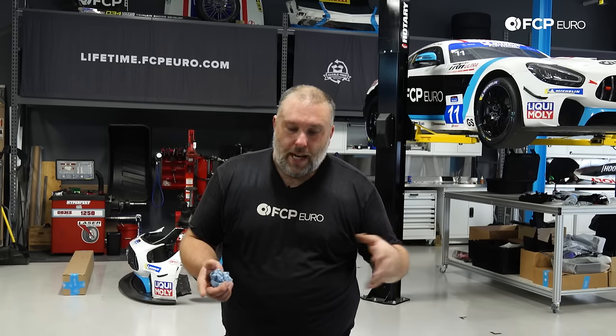And the reason that could potentially happen on this engine is BMW simplified the oiling circuit by removing a lot of passages. So through that simplification process to make the VANOS system more reliable, it is possible for air to get trapped in the circuit. So that will cause an interruption of oil flow through the engine. And if it's running, obviously it's going to dry out very quick. Whatever oil film is between the bearing and the main or crank journals, that's only going to last so long if there's no additional oil coming through.